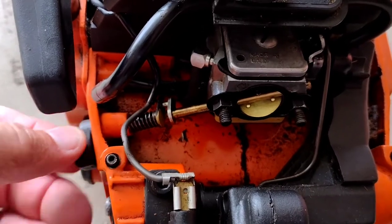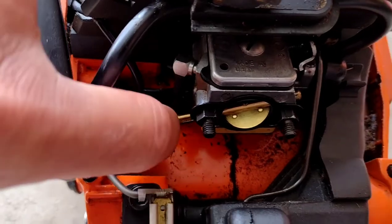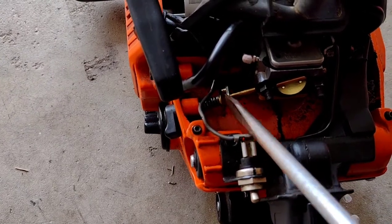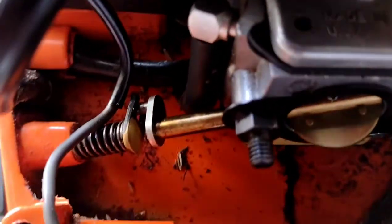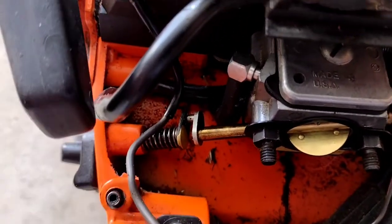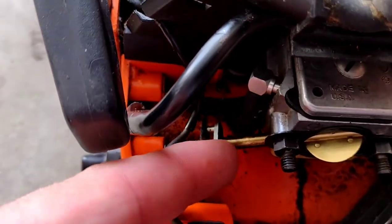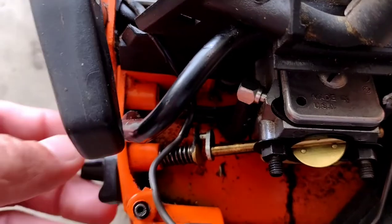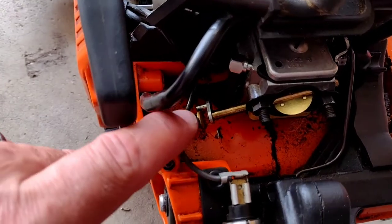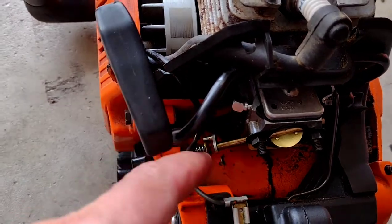Before doing that I want to mention how to get the choke detached. It has a little pin down here — use something to pry against it; that's what the spring is there for, and it's attached to a piece of plastic, so that could break, so be careful. Basically you compress this and that little pin comes out. Flip it around and that detaches the choke. So I compressed it, turned it up, and that freed it.